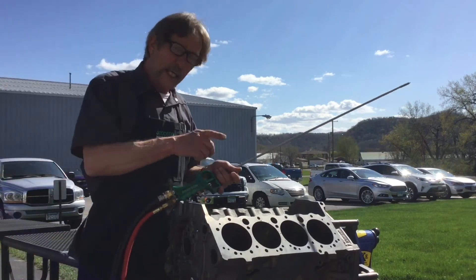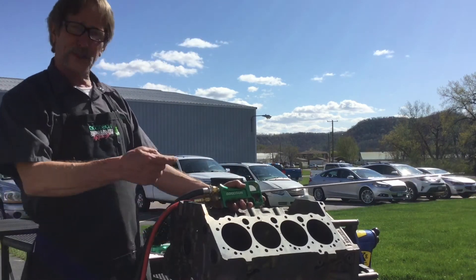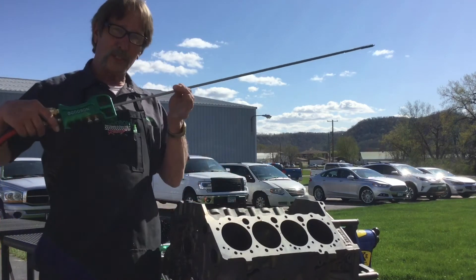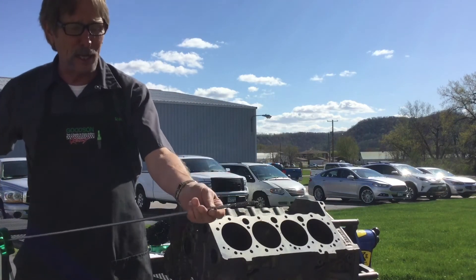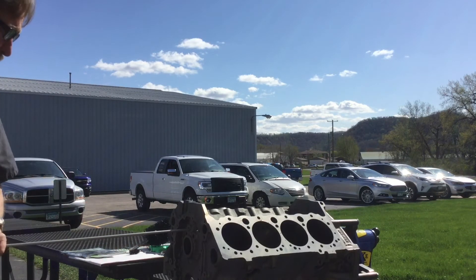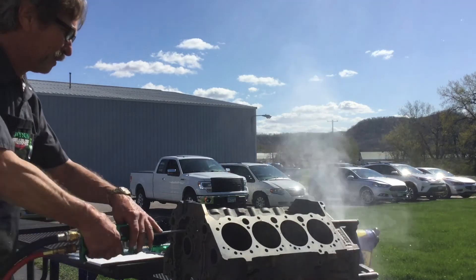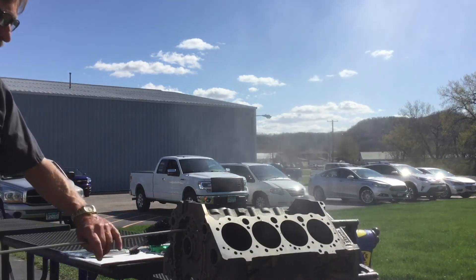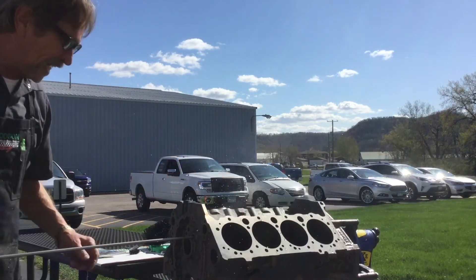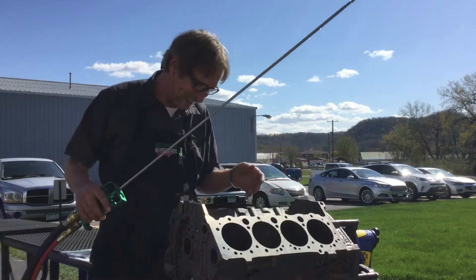In the old days, you'd put an oil galley cleaning brush in there, run it back and forth, squirt some water, then squirt some air — brush, rinse, and repeat over and over. This tool does all three things at one time: aggressive cleaning action of the brush plus the spiral turbo action of air and water simultaneously. Let's see how it works — we'll get into this top oil galley with water and air, working back and forth. You can see it popping up through the lifter holes, getting the oil galley nice and clean all the way through.